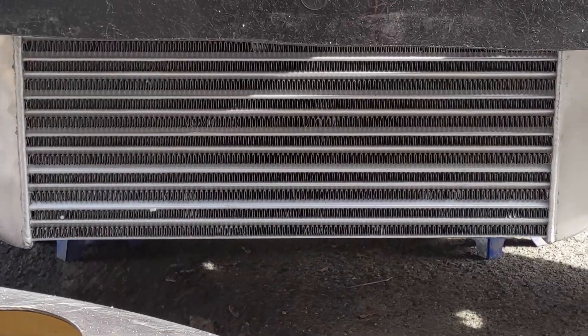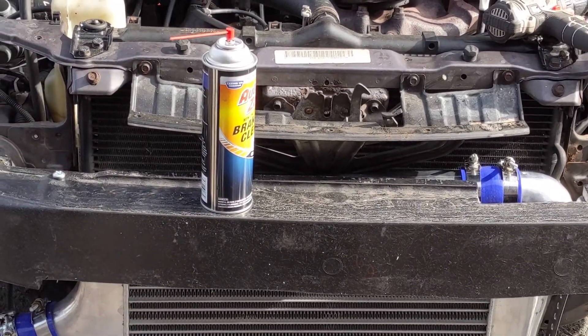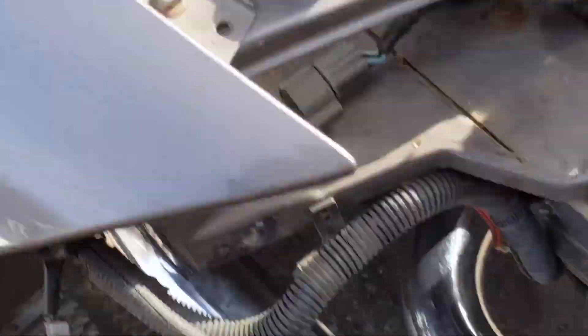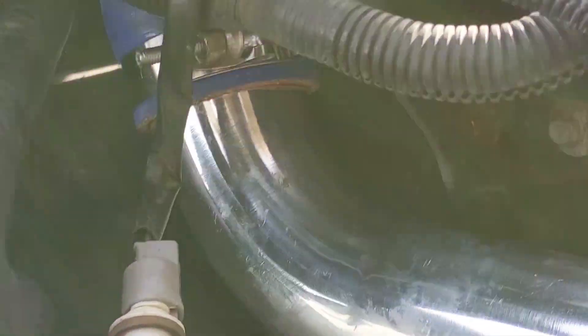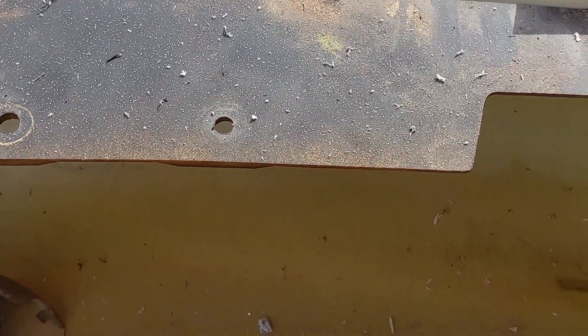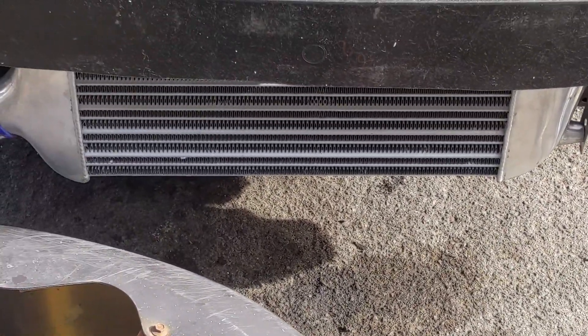I think I've got this thing locked in nice and tight. I'm going to tighten up the hangers for the side mounts of the intercooler where I've hooked up the straps. This pipe is nice and tight going straight across - it goes straight through the frame where I did fit a coupler to keep it from blowing a hole in it. Down around the side we routed from the bottom where the turbocharger hooks up, that comes straight through and runs right into the bottom of the intercooler, and out the top side this pipe goes straight up through the factory hole and up into the throttle body. That is it. Now I just got to throw the bumper back on. The only part I trimmed was right here - I flipped it upside down and made it flush with this metal right along here, which gave me just enough clearance. I'm going to cover up those transmission lines, tighten up a couple of brackets, and then we are done.